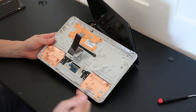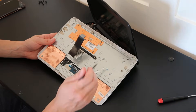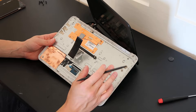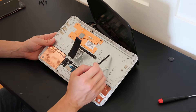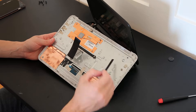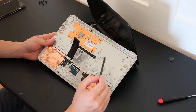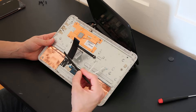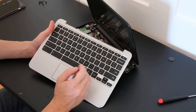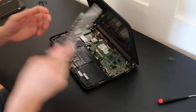If you need to access your touchpad, it's right here — unscrew these screws and you can get it out. Keep in mind that in this model, as in a lot of little Chromebooks, your keyboard and touchpad aren't always held in by screws. There are little plastic rivets holding the metal panel. If you decide to swap out your keyboard you'll have to break those permanently, so we advise replacing an individual key instead of the entire keyboard. We'll have a link for that in the description.